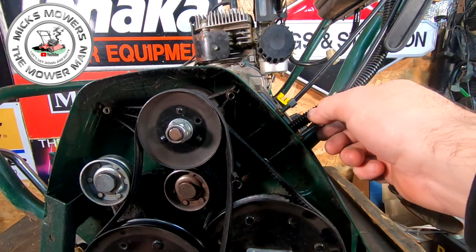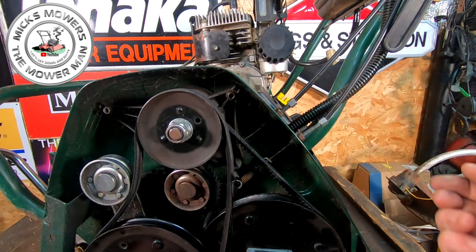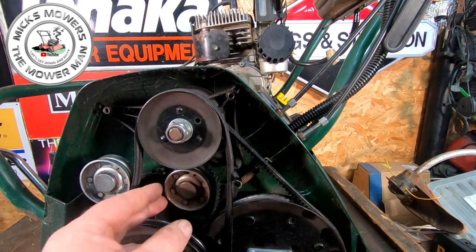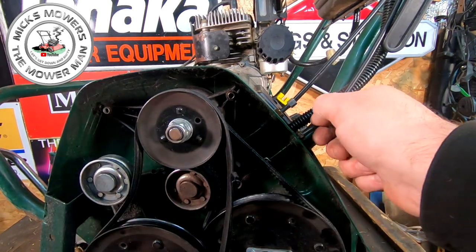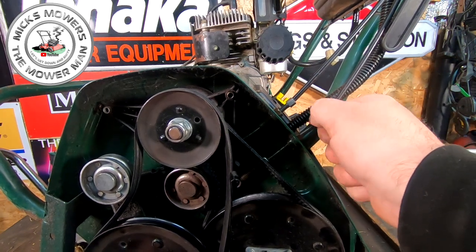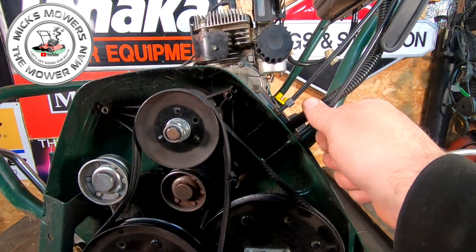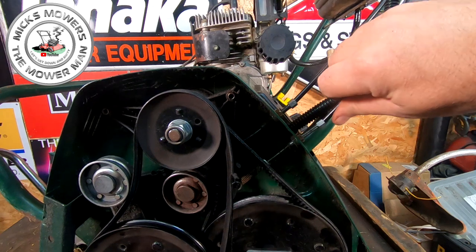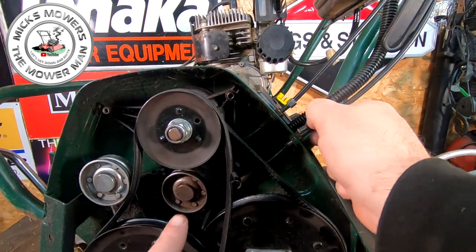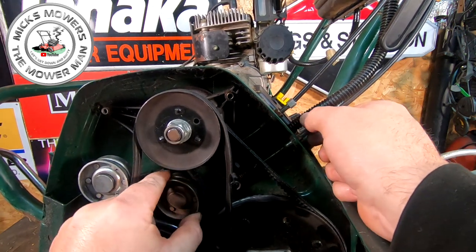And if you want to then just adjust your drive, because you've got no drive, just unscrew it a touch, about 2-3 turns, then try it. If you don't get it, do a bit more. That's taking the tension up on here, which is pulling this pulley over. And when you put a new belt on, okay, you have to screw that all the way back in, pretty much sort of 3/4 way back in, until this pulley becomes slack. All right, so just keep winding that in, because there's not a lot of slack on these cables. Okay, right, now you see it start to slacken off just here. You'll see that pulley start to go off, okay? There you go, so it's moving now.